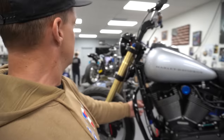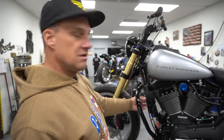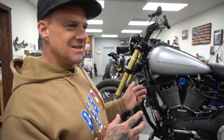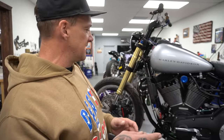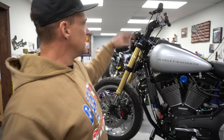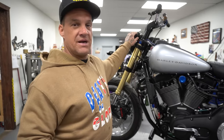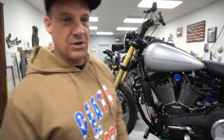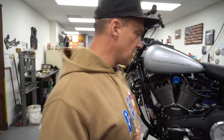I'm pretty sure this is on the website. Yep. It's on the website. What do you know? Whole fan kit, it all comes together. I think it comes with a temp switch. I'm not sure if you gotta buy that extra, but normally you run a temp switch and it turns itself on at certain temperatures, but I didn't want that. I wanted just direct power, run it the whole time. So when you're at the lot, you're just up and down, and they're burning hot all the time. I wanted to cool that thing down hard and fast.